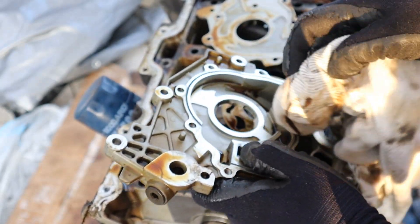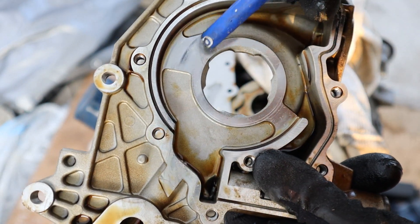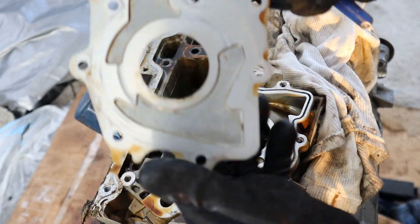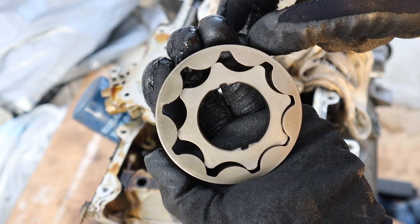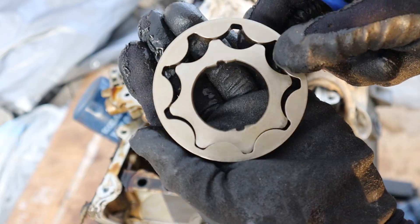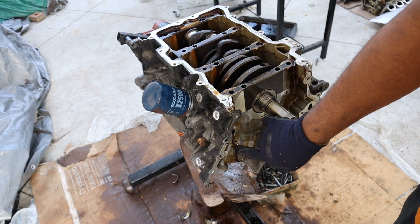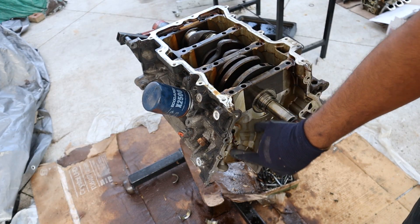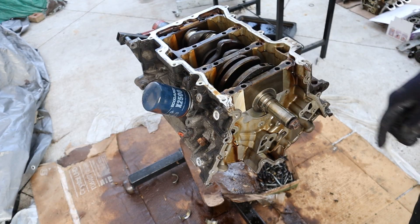Taking a look inside of the oil pump housing, you can see there are some scars inside — like some material ran through here. Moreover on the housing over here, you can see a definite scar, and the gears themselves have some minor scratching. But they are harder because it's made of steel. One thing I like is that the oil pump sends oil down into the block directly — straight into the oil gallery to the oil filter, without having to pass through the upper oil pan.